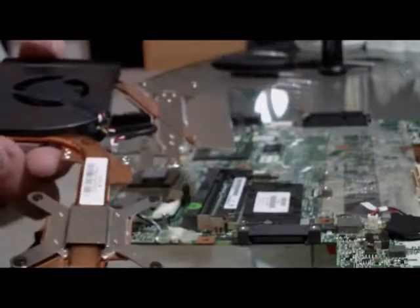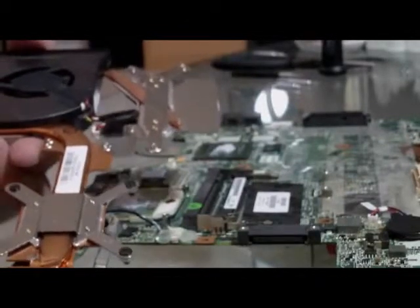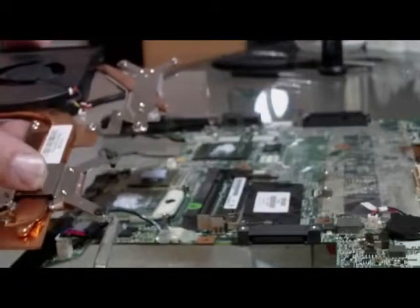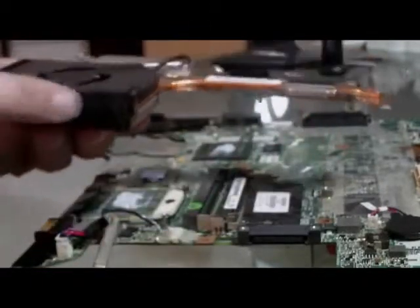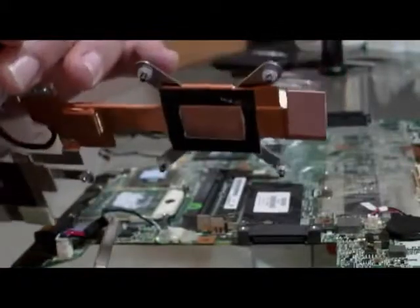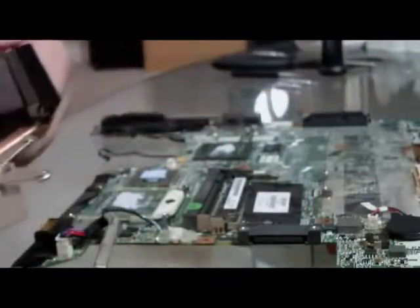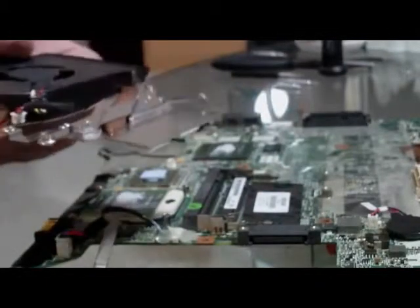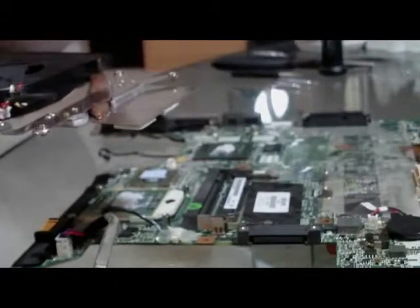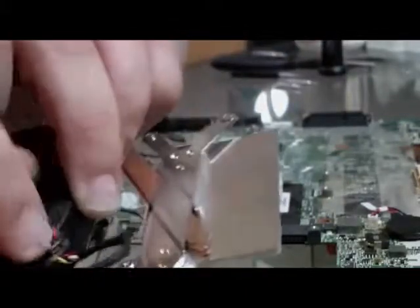One other thing that I'll show you here is that we've got these copper tubes, and what these copper tubes are, they kind of work like the hoses on your radiator in your car. But in here there's glycol, and as it heats up, it evaporates through this core over here to this little radiator unit, and as the fan turns, you can see the fan underneath here, it pulls the heat out of this copper right here and dissipates the heat into the air. Same thing with the video GPU. We've got another glycol tube over here. It's a sealed tube, and so once the heat is pulled off, it cools off back to liquid. It kind of flows along the bottom, it evaporates again, comes back, and so it's kind of an enclosed circulatory system. Anyways, we also have a little power plug here for the fan.